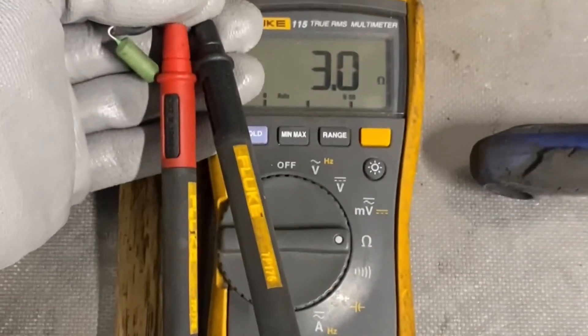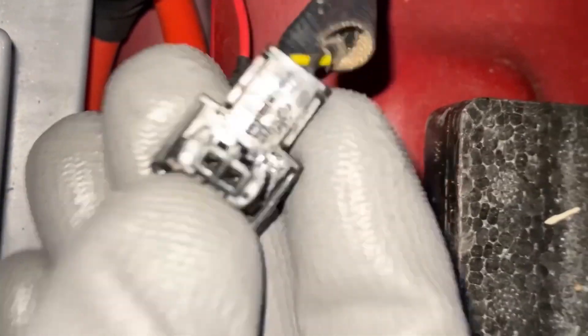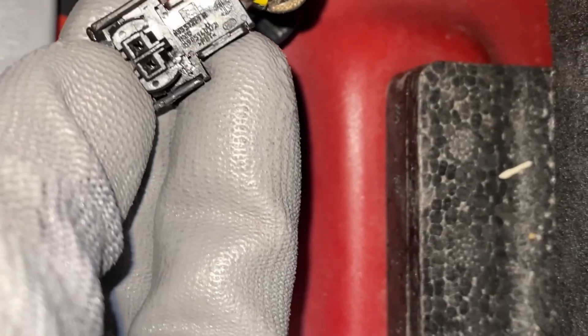Just a quick test — we'll just use that as a substitute for the airbag safety terminal. All we need to do is pull that out now and put our resistor in there. It's as simple as that, and that way we can check all the wiring from here right back to the airbag control unit.